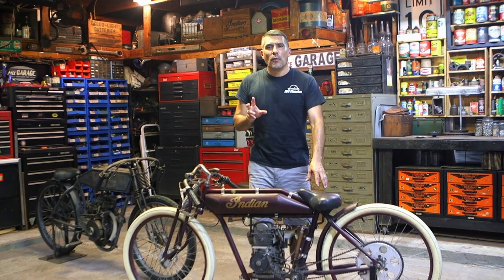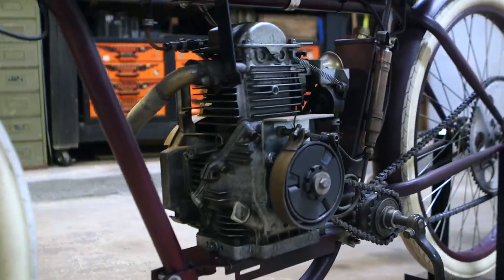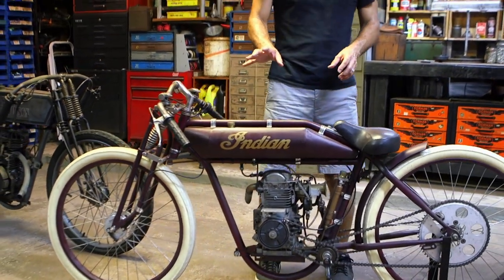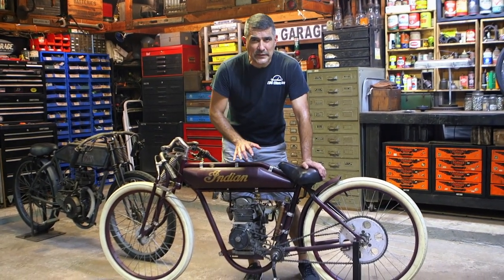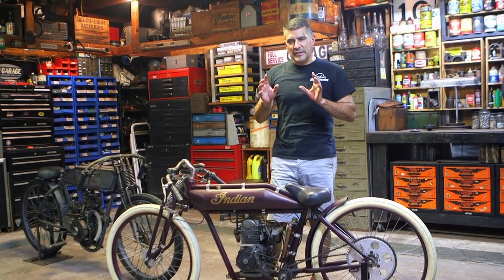Keep in mind that this setup works best for us with the motors we are using — this one is a Honda GC160, and on my Harley tribute that's a GC190. Both are very similar four-stroke motors running straight gasoline. For you guys running two-stroke motors — nothing wrong with them. When we first started we were using a two-stroke as well, and those bikes can be great fun. It's a less expensive way to go, but for us we were really trying to mimic the sound as closely as possible. The two-stroke motor setup will be completely different from what we have here — this is mainly for your four-stroke motors, Honda motors, Briggs motors, and similar.